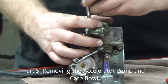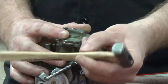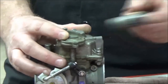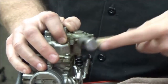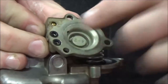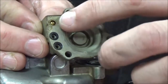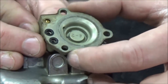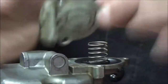Here's my carburetor hammer — a small lightweight lead hammer. I never hold it back; I just hold it up near the head to let the weight do the work. Notice I still have the carburetor bowl on for support. On this accelerator pump cover we've got a couple of O-rings and a pressed-in ball. Don't go crazy with the air gun or you'll start losing pieces. In a hot parts washer at 130–150 degrees, the aluminum can expand and that ball can fall out — take a picture first.